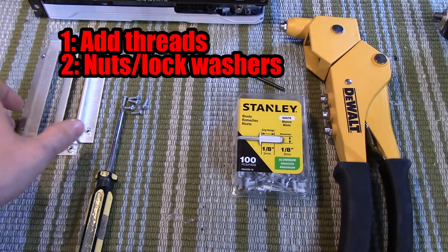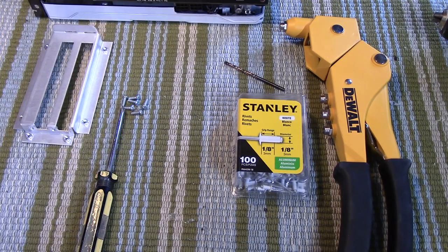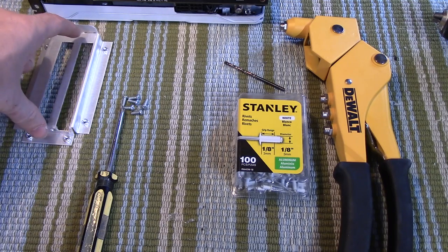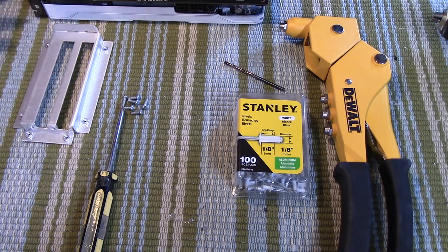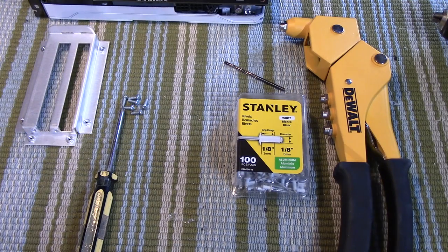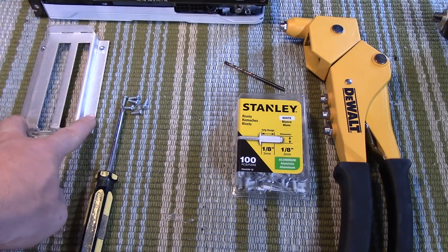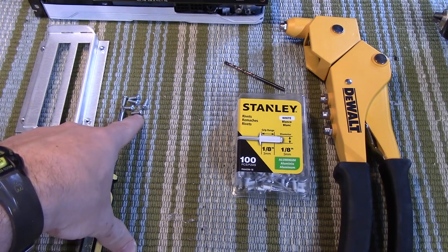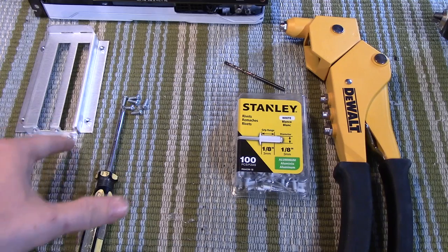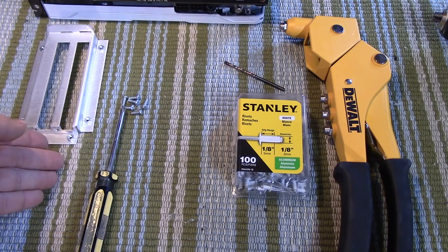First of all, if there is a flat spot in your case that you can fit the entire mounting bracket onto, all you need to do is make a large enough rectangular hole where that flat spot is in your case to fit the I/O ports on your GPU through. And then drill a bunch of tiny holes around that rectangular hole to fit all of these mounting points through. Then you want to make threads in those holes so that you can thread these screws through these mounting holes on your bracket and then through the holes that you just made threads on in your case.